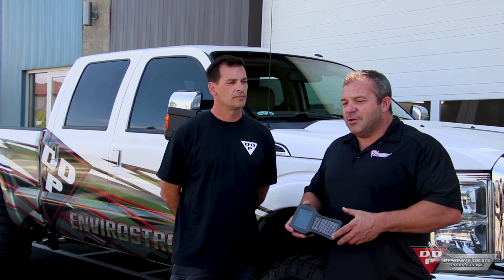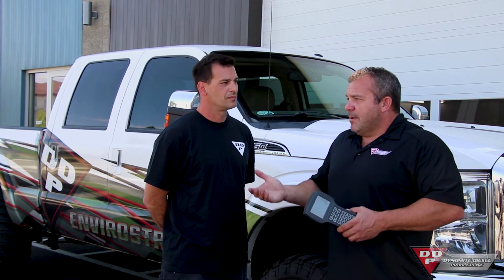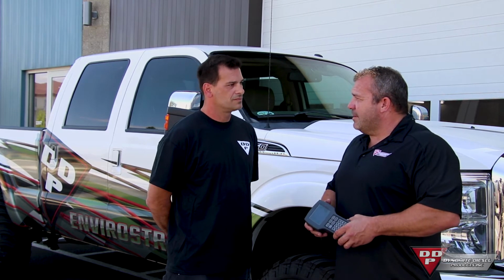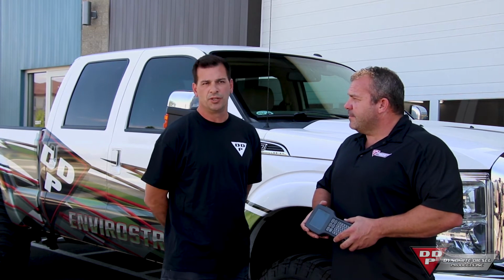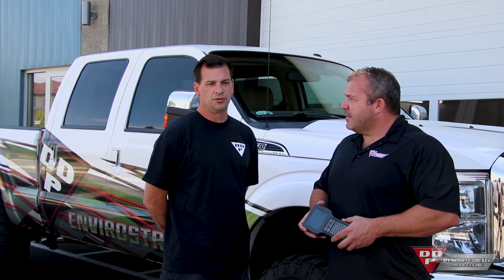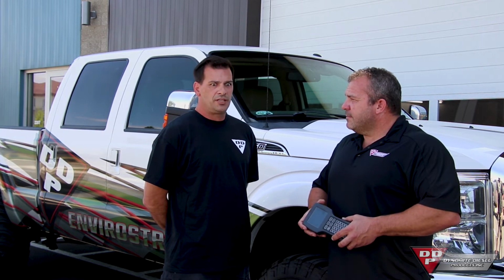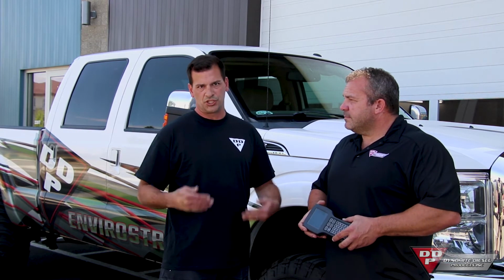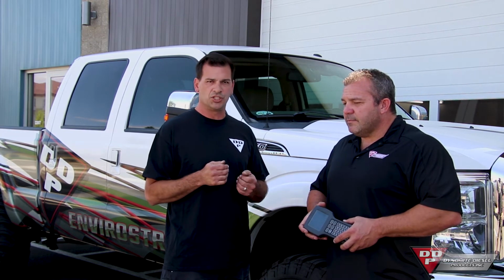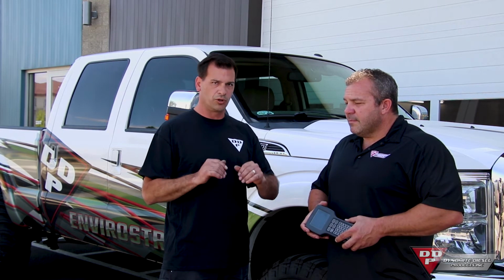The time that we spend on the injectors, going from surface grinder to EDM to some extrude hone, well, back to the extrude hone. How much were some of the recipes taking us per injector compared to now? Definitely, yeah. Some of our old recipes, we were seeing that the extrude hone time was going into the near minutes and such, and we found that not only is that a waste of our time, but there's better ways to do it to increase the efficiency as well as the economy of the injector, and that's why we've stepped back and looking at some other modifications that we can do internally in order to make the nozzle work better, instead of trying to make the nozzle do all the work for us.